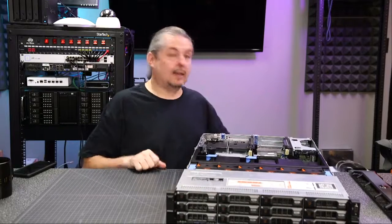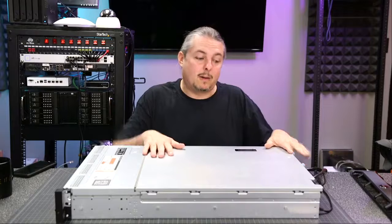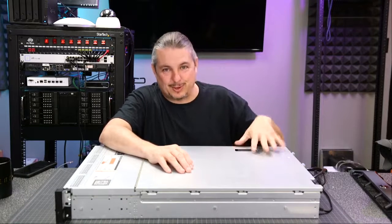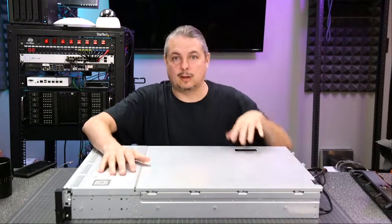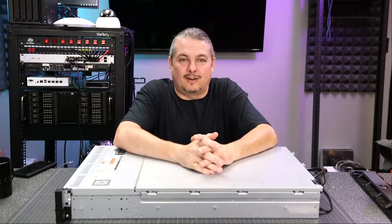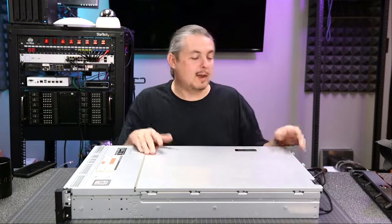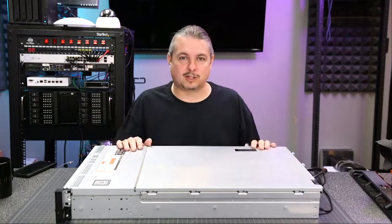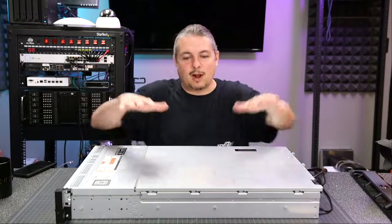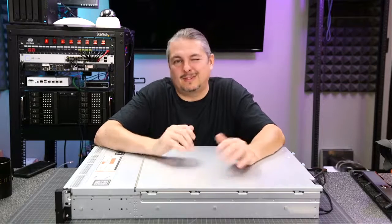The next question people ask is how loud is this thing? Not quiet — that's why we're going to be finishing in the other room. When you first plug it in there's a little bit of a hum, and the iDRAC system is booting up because there is a lights-out management system. You can manage this with only that much noise because it hasn't powered up the motherboard yet. Let's go ahead and turn it on and hear the full noise. It takes a second before it idles down, and the fans are variable speed. There are some adjustments for how much you want to rev the fans, but generally I want them revving up if the server is under heavy load. It's not unreasonably loud, but probably a little louder than you want sitting next to you while doing a video — it's just not going to be whisper quiet.